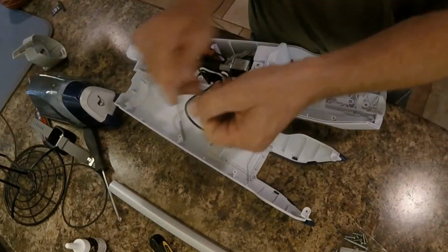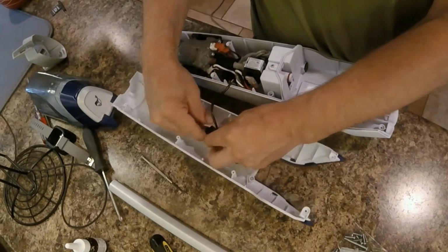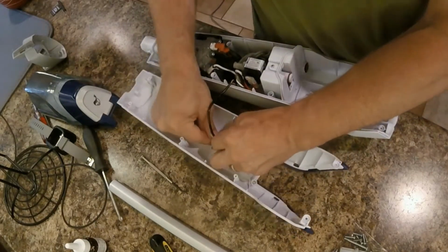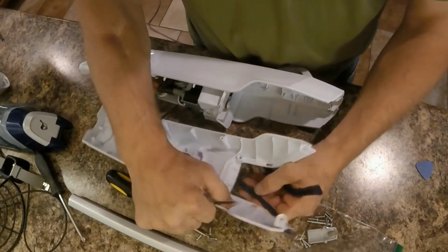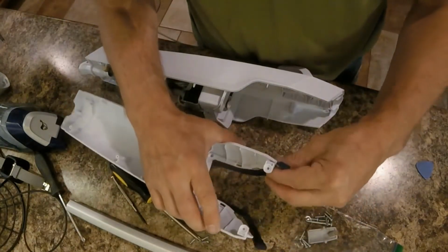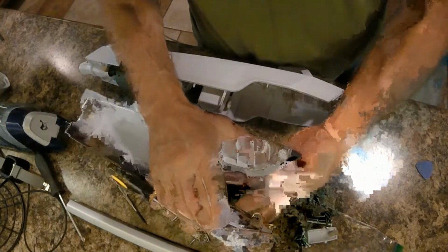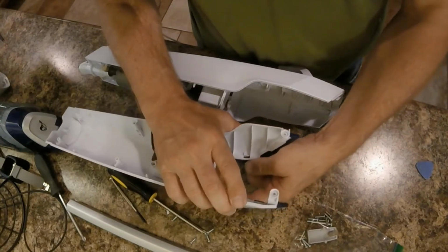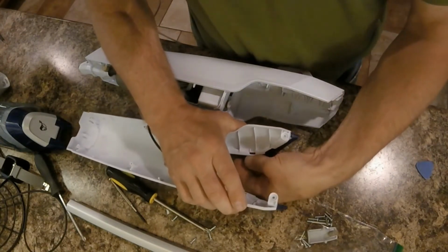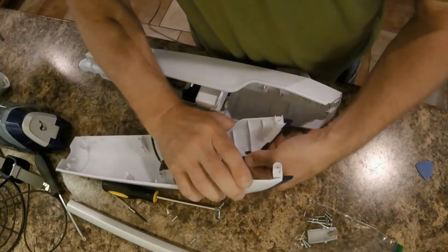This part I just show you me assembling it. There I am attaching the connector. There's a little rubber boot that goes around the connector, and I'm attaching it around there. This purple bezel that I'm attaching, you need to do it in a specific order. You need to attach the end of it, and then the 2 little tabs snap into the side. So that's what I'm doing right there.